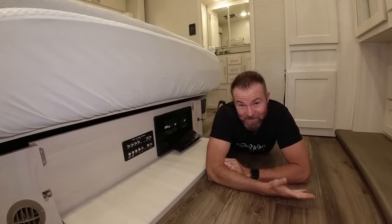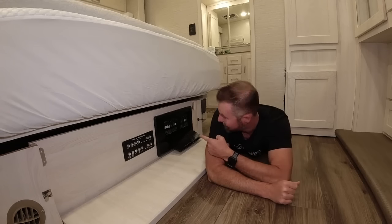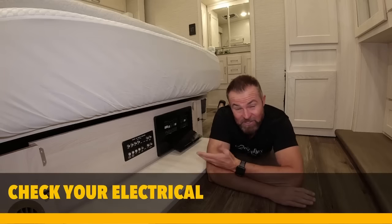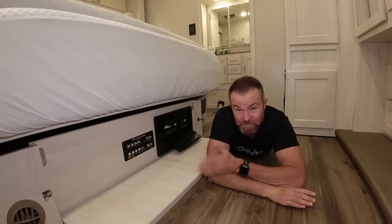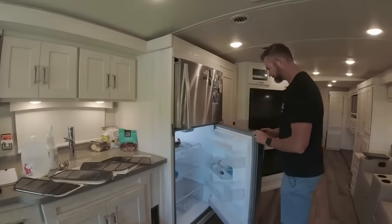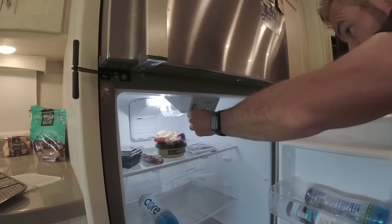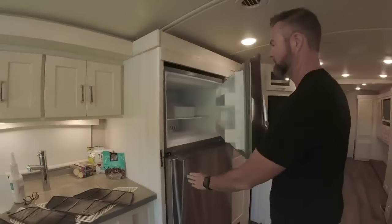You've got to have a little bit of fun when you're going through the de-winterizing process. We're talking about electrical — I'm right where the breaker box is. The Winnebago Forza has three different breaker boxes: one for the chassis, one for the coach or the house, and one for external lighting. As you get ready to de-winterize, you're going to want to think about all your electrical. Know where your breaker boxes and fuses are — that will eliminate any problems when you're out on the road. Number one: test all electric appliances to make sure everything is working. Make sure you're plugged into a 30 or 50 amp source, or some appliances might not run and you won't be able to test the system.